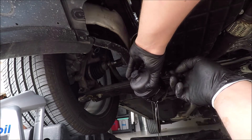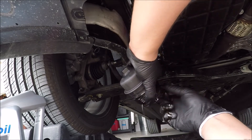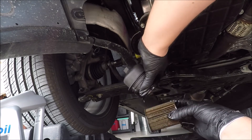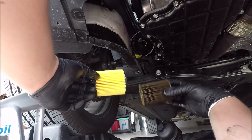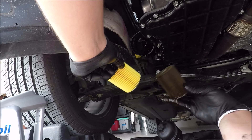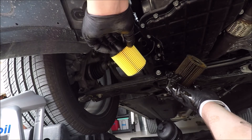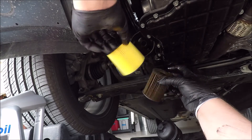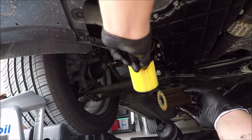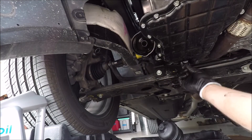With a bit more turning, we've got the filter cap off and the filter element out. Now comparing what came from Kia versus the NAPA Gold — the OEM filter is just a paper cartridge with a paper gasket on each side and a plastic frame inside, whereas the NAPA Gold has a plastic or rubber cage on the inside.